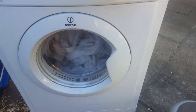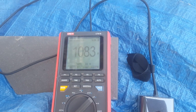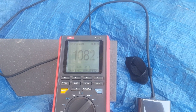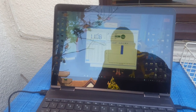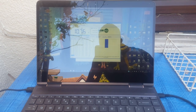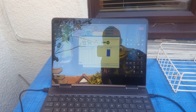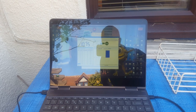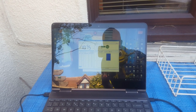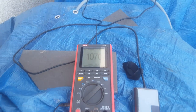We just need to check the drying manually, so we'll set it for an hour and see what happens. It's drawing 10.8 amps — nearly 11 amps, that's a lot. It's registering on the computer. The rig is only designed to handle 10 amps and it's drawing more than that, so we could end up with a bit of a short test. We're drawing about 2,000 watts — actually maybe even more, about 2.3 kilowatts. Maybe it won't take so long to dry if it uses this much power.